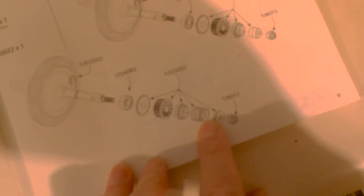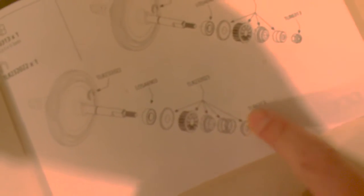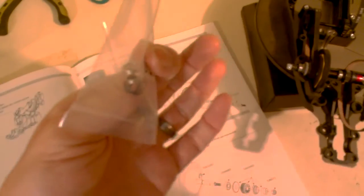But they do tell you, in either case, how to set it up for either full-time 4-wheel drive or with the clicker assembly. The only difference is here you have this little red aluminum sort of hub that you just lock against the clicker. Otherwise, you would just have a spring with a little plastic end piece here and a nut, and you can adjust the tension. What was kind of neat is that they actually give you 2 springs, a soft spring and a medium tension spring, depending on how finely you want to adjust that clicker action. So I think that was nice of them to do.